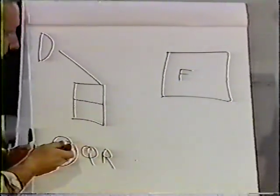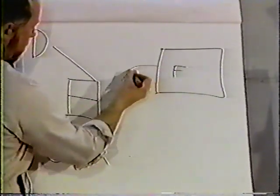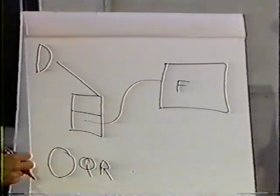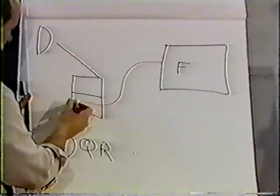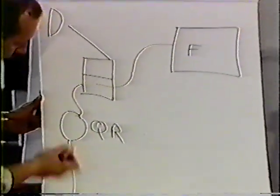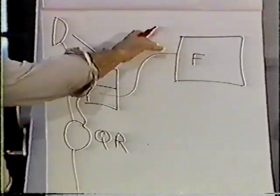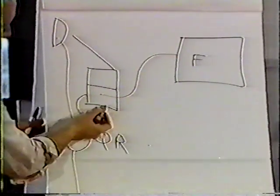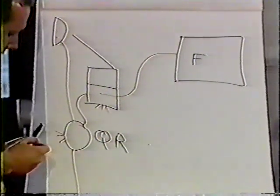Now we're getting our air from our supply through our single check valve. And that front pressure enters our secondary circuit, furthest from the pedal of our foot valve, and when the driver activates the pedal, that pressure enters the quick release valve. From the quick release valve, it enters the front axle chambers, applying the front brakes. When the brakes are released, driver's foot is off the pedal, chamber air is exhausted from the quick release valve, and service or signal air is exhausted from the foot valve.